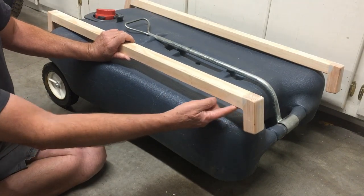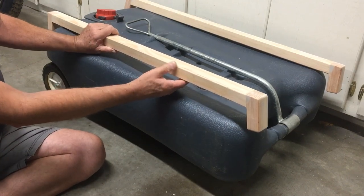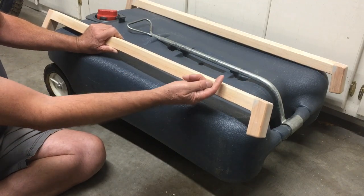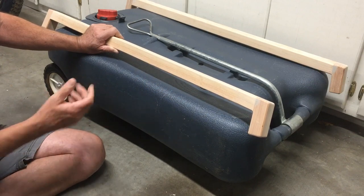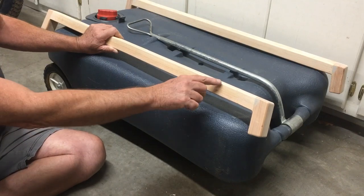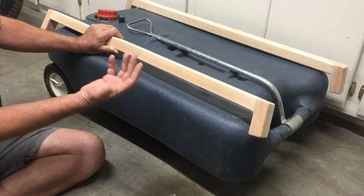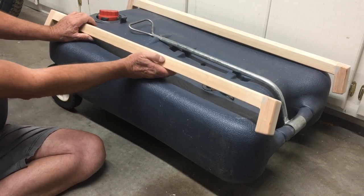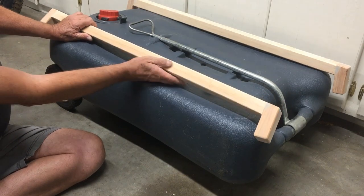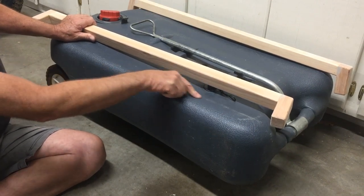The routed edges won't be cutting anything - the fabric underneath the trailer or the tank - it'll be all nice and smooth edges. Once I have the rubber adhered on here and everything's painted up, I'm just going to put my glue along here and run some screws into the floor. The floor is like a half inch thick, so I'm just going to have screws protrude a little bit to hold this in place. The screws will go into the rubber slightly so I won't have any screws hitting on this plastic to wear it out later.